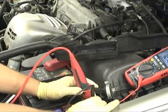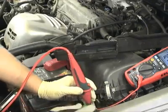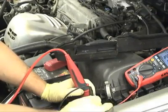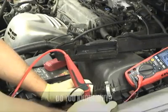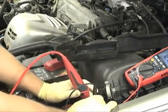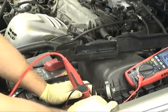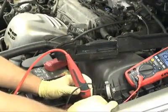We're checking it the same way. I'm hitting the horn. Even though you've got the 100 ohms in there, what are you reading? You're still reading 12 volts here. Ask yourself, am I reading a static voltage? I haven't applied a load to the circuit — all I'm reading is static voltage, and it's going right through the resistor. It looks as if we have a properly functioning circuit. This is where the manufacturer instructions fall on their face.